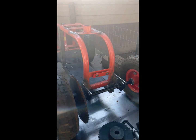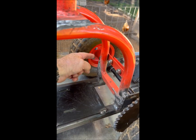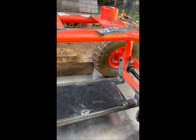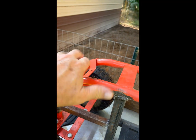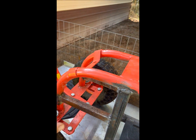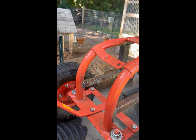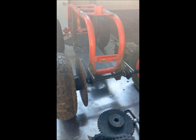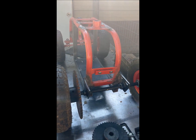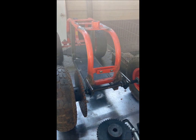The jack shaft is in place. I haven't ordered the disc brake yet that's going on that side. I made this cradle here for the engine, and added some support in this area that would have been a stress point from flexing — I just want to make it more rigid. Next I have to do the steering — I'm going to run a pipe up here with a steering T-bar. After that I'll mount the motor, chair, and gas tank and hook everything up, and she should be rideable.